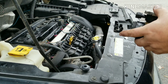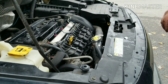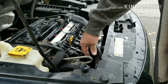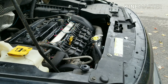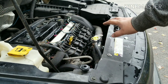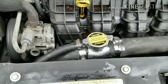I'm going to run this a bit and make sure everything is good and that we don't have any big leaks. So far so good. I'll probably take it for a few test drives. I'll let it cool down and double check the coolant level — when it cools down that's when it sucks from the reservoir chamber. So as long as there are no pinhole leaks it'll pull that fluid back up and try to top itself off. I think it's time for a test drive.